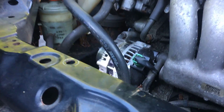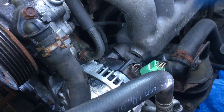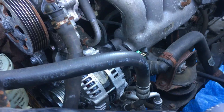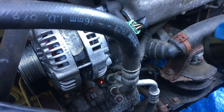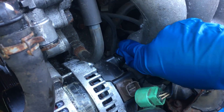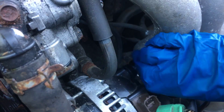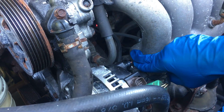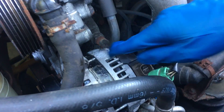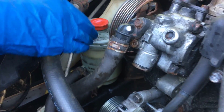Getting to the process: first, take out this plug. Then there are four bolts to take off — three main ones: this one right here and two down here, this one and this one. Then on the side there's this bolt right here. This side bolt is much easier to take off after you've taken the other three off. To make the job easier, we're going to move the power steering fluid reservoir — pull it out and move it off to the side.